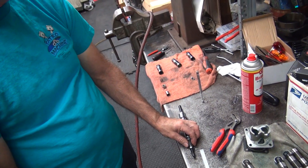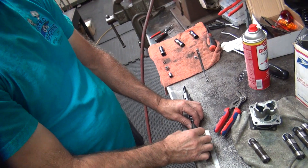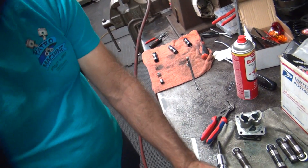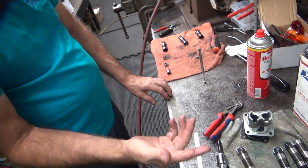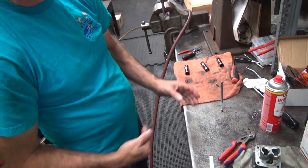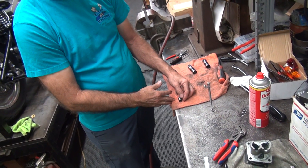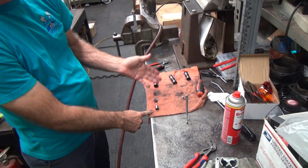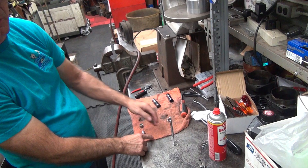That's bottomed out at twenty, we went down to six flats and bottomed. So it's twenty-five to twenty-six flats total — that's where your lifter's going to bottom out, and that's called a solid at that point. The solid sounds the best so far. If we go 18 flats we're kind of in the middle of the range where it should be. We've got 26 total, so 13 flats would be the middle. At 18 we're two-thirds in, and when it heats up it'll come back to about 13. So about 18 to 20 flats max.